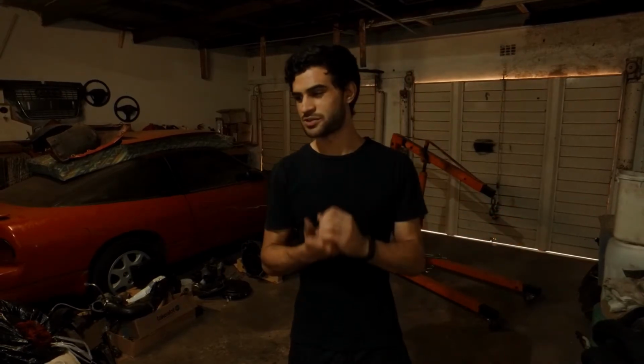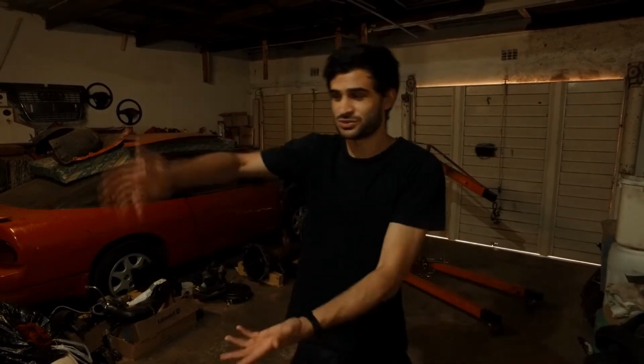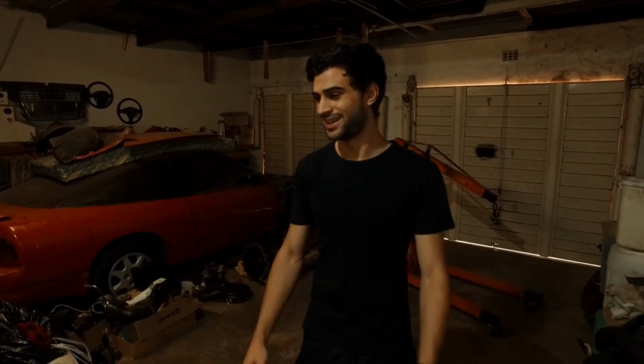I also don't think we're going to meet that goal because I went past Tyrant's place just to see what there was, and I ended up buying a hot cam, so we're about to do a hot cam swap. We also may as well just do lifters and valve stem seals while we're at it, and since the head's open, we just may as well do it, right?